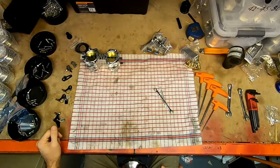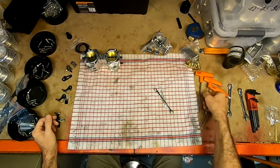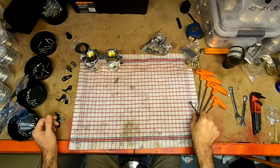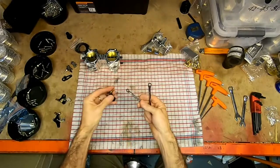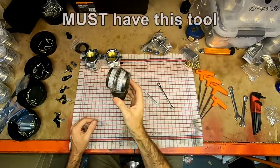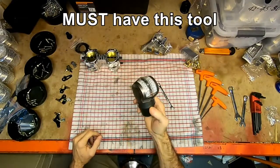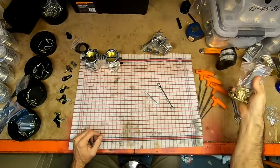Now we're going to go through the installation and first the assembly of our M50/M52 ITB kit. You can see I've laid out everything ready. Typical tools you're going to need: allen keys, spanners, sockets. You're particularly going to need small spanners — a six millimeter and an eight millimeter — they'll be used for all the adjustments when we come to set it up. You also must have one of these; there is no alternative. This is what's used to balance the throttles once we get it running, so you must have it — you can buy them off eBay.